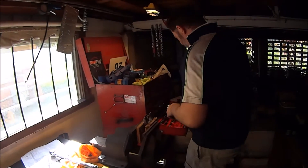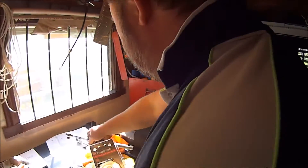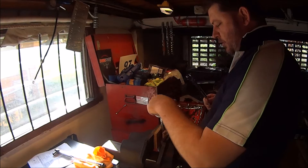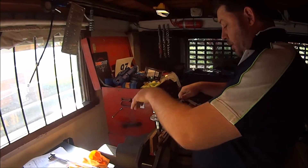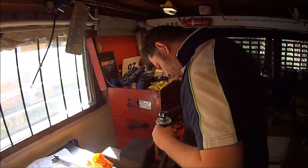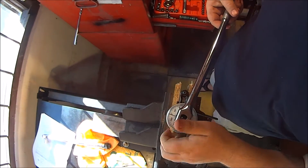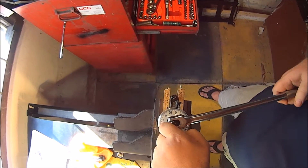Then 60 to 65 degrees — for that we need a different tool. We need a breaker bar, and I went and bought this today just to do this job. I keep having issues with holding this thing where it needs to be held — this is a cheap one. I might be better off just eyeballing it for this purpose, not for assembly but for this purpose. We've got the locking mechanism there, so we're aiming for 60 to 65 degrees.